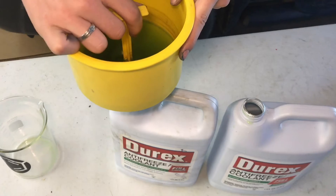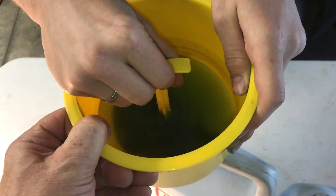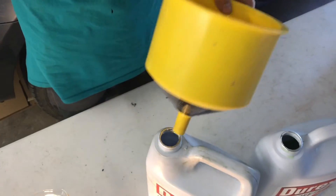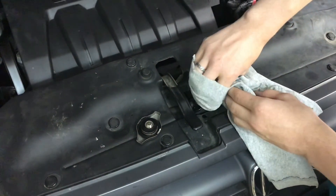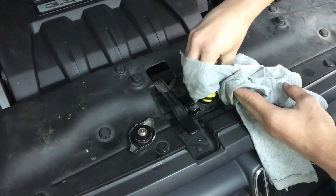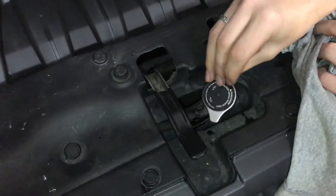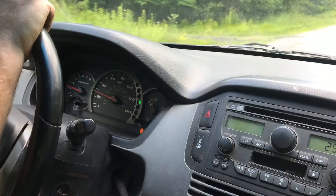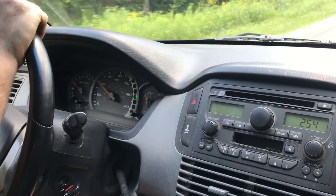Just put this on top and then pull out the plunger — pull the plunger and it will drain out. It was a little tight, but it's super convenient. Carefully with a rag, we're going to take off that cap there and our connector, then reinstall our fresh OEM cap. That makes the job a lot easier. If there was air in the system, the engine would overheat, but it's doing great and everything is running smoothly.